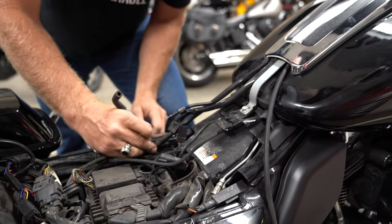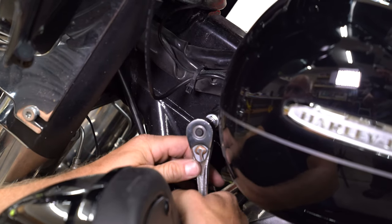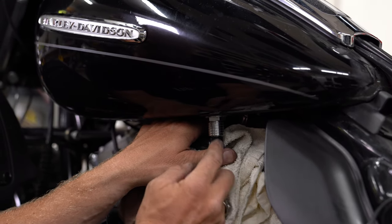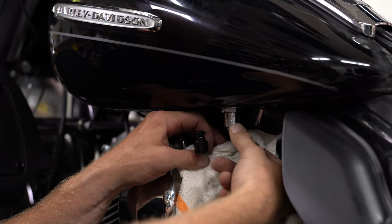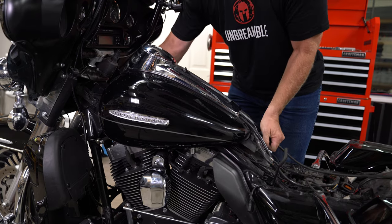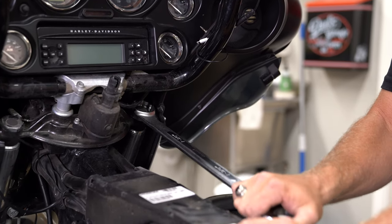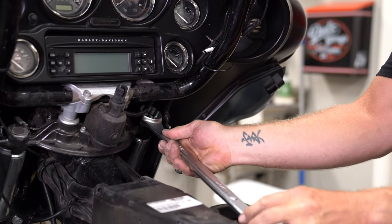Now we've got everything disconnected. You may have to snip a few zip ties to release your wire harnesses. With a Torx T40 and a ratchet, he's just backing this front tank bolt out — one on both sides, that will free the front of this tank. Underneath the left side of your tank is the fuel line and valve. He's going to push up on the bottom part with his thumb, then with his other hand pull up on that metal sleeve while pulling down on the black part at the same time — you will lose just a little bit of fuel. With all that removed, he's going to lift on the back first and just work it off the backbone and set it aside. With the tank removed, we've got a 1-3/8 inch box end wrench and he's going to go ahead and break the right fork cap nut. It just makes it easy with the tank off to do that unless you have a fork cap wrench — I will link to the fork cap wrench in the description below.